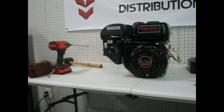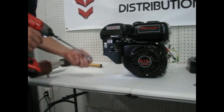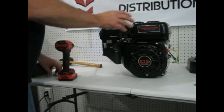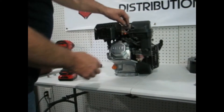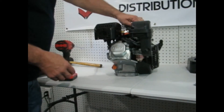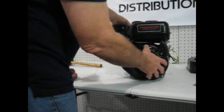The first thing we're going to do is remove the airbox and this front shroud. There's a hose over here that goes into the valve cover — pop that out. There's a little wrap-around wire thing; unwrap that from the hose. Bring the engine back around, undo your airbox bolts, and you can just set that right up over the back of the engine.